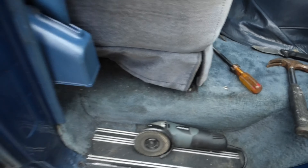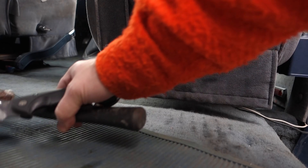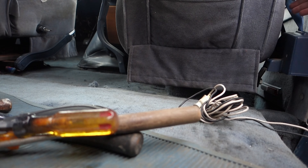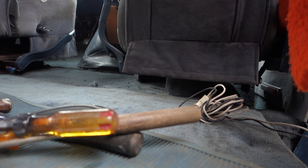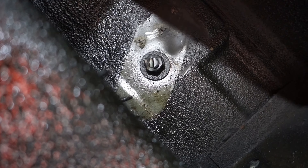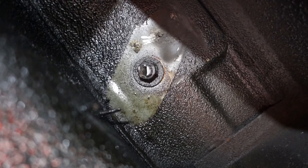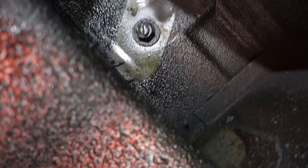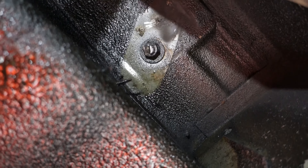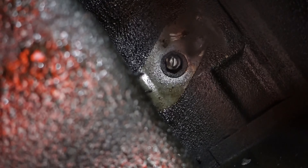Now for the back two bolts — I've got the two front ones out. I'm going to slide the seat ahead and bring all my tools of destruction back here. I'll pull the lever on the side of the seat and push it ahead as far as it'll go. It's in under that bar, so it's going to be a real joy. It's a 5/8 socket. I took the grinder and cut that stud right off just below the nut, and now I've got to get a pair of vice grips onto that nut so that when I turn the ratchet from the top, the vice grip will turn and jam against one of the side rails — I'll be able to hold it because the nut is shallow.